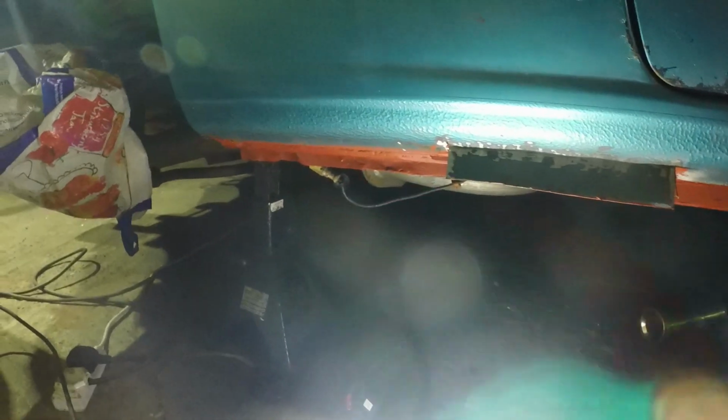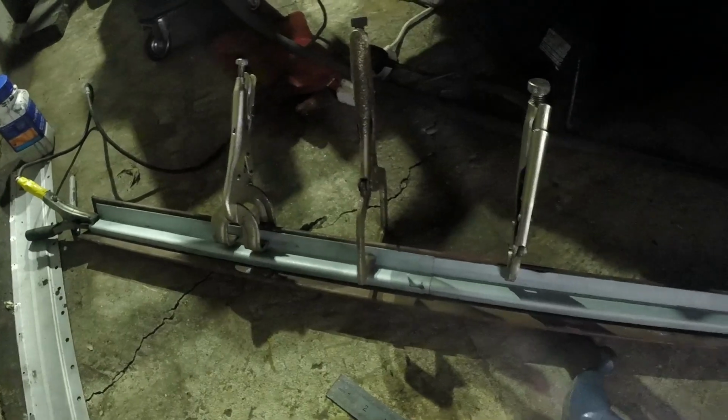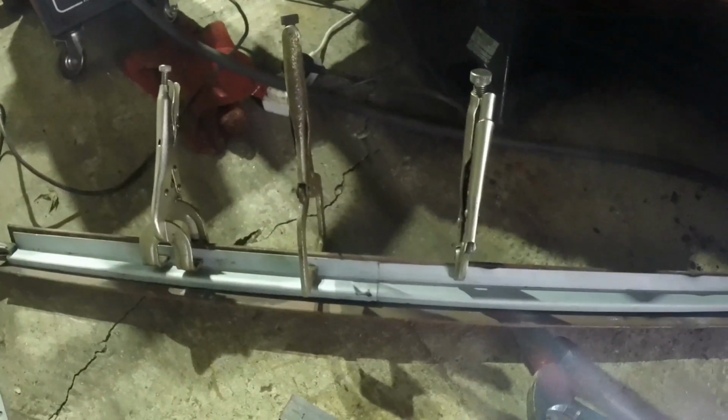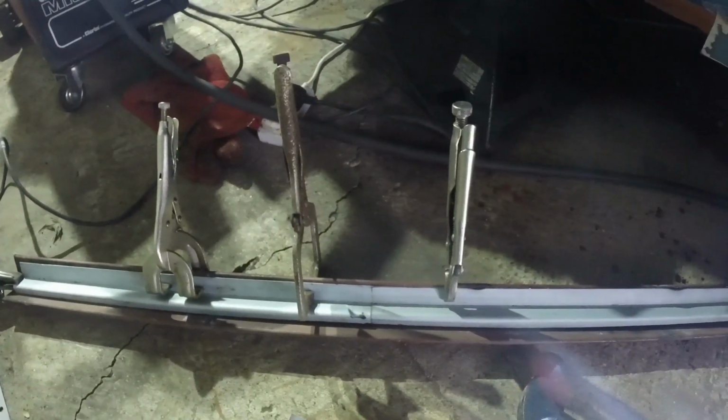So that's those two. I've made more than I need, so the first thing to do is weld them together to make one full length, put the holes in it, chop it to length, and I also want to see if I can replicate the two sort of grooves that would have been in it over here, which locate the emergency jack. So I'm going to crack on, weld that, trim it down, put the holes in and fiddle around. Once again, I'm using James's patented metal former. So that's just to clamp it straight while I weld it.